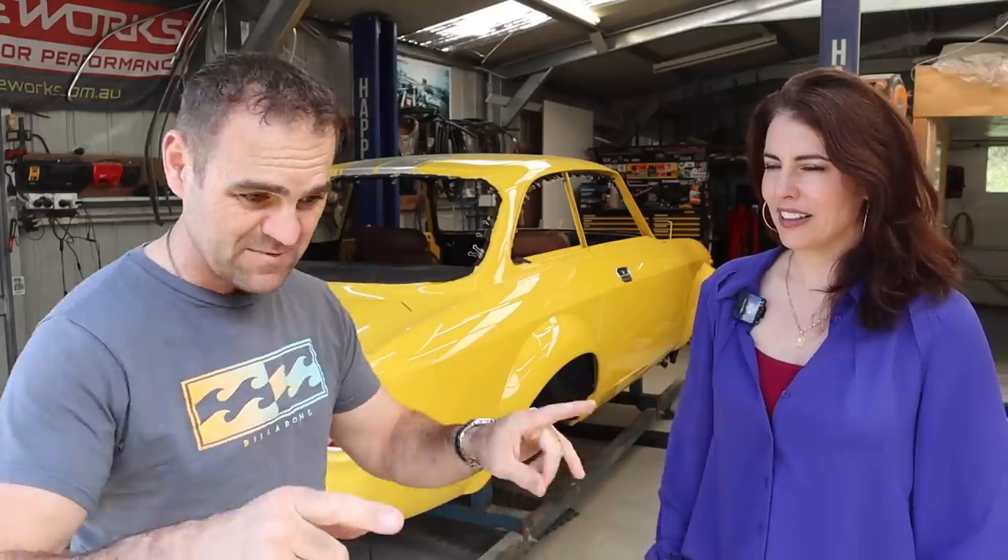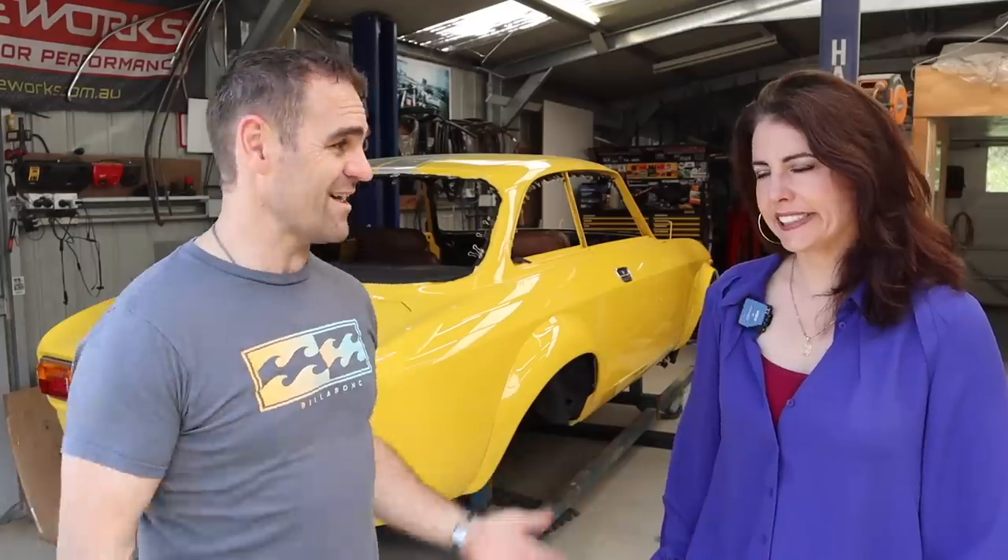That was a very boring episode — wiring is never fun. But I actually discovered something I missed: I always assumed there was a speed sensor pickup built into the gearbox, but it's a modern car that uses wheel speed sensors for ABS and stability control, so it doesn't need one in the gearbox. The two plugs in there are for the reverse light and something else — not a speed sensor. So I'm going to have to fit one to the diff somehow, similar to what I did on the 911. Just another thing I missed along the way, but I'll work something out.